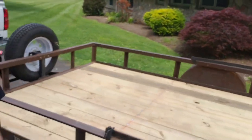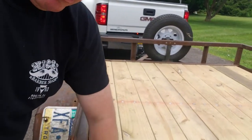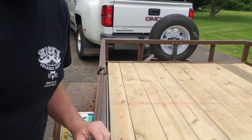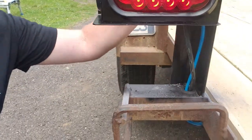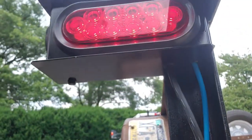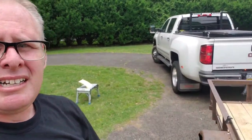Another component is responsible wire routing. I have conduit run all the way along the trailer, and grommets wherever the wiring passes through panels or frame sections so it doesn't chafe. You can see down here I've got a grommet where the wire passes through, and more grommets where it passes up through there as well.